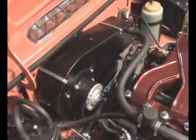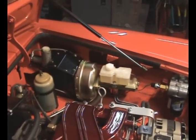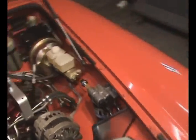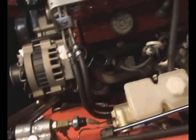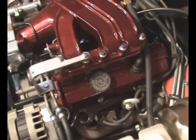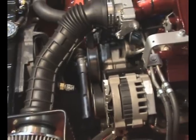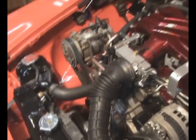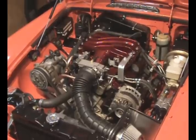Maybe in another video I'll show you a neat trick for getting the box in without mangling your control cable — you just have to work through the little vent on the side in the footwell passenger side. Worked fine though. New brake reservoir and plumbing has been working pretty well, no problems there. Finally got a proper pressure switch — kind of generic, about 7 PSI shuts down — gives me an idiot light for oil pressure. Motor had been in and out a few more times, a few more clearance issues. Stacked some washers under the mounts to get the positions and clearances I wanted — gave me a little more clearance on the pulley. Still haven't bothered with the A/C, but that's coming — just trying to decide on what internal units I want to use.